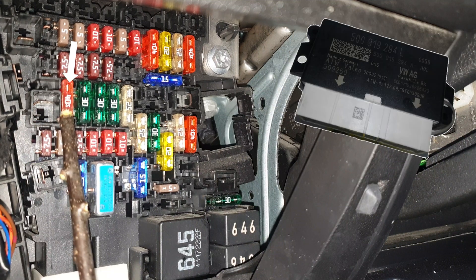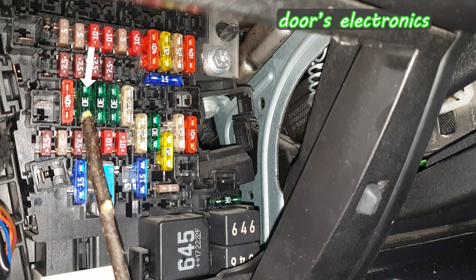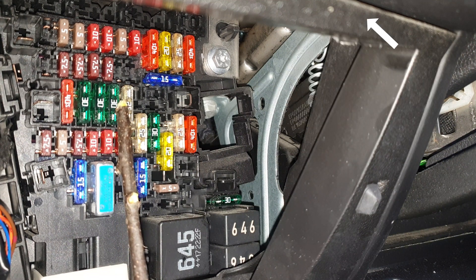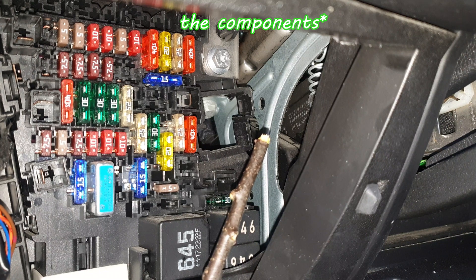This one is for the onboard supply control unit and front right headlight. All doors control unit, seat heating, and again onboard supply control unit. You'll find this onboard supply control unit if you remove the dashboard on the left side — it's mainly responsible for cutting off the power to prevent damaging components when they're activated for a long time.